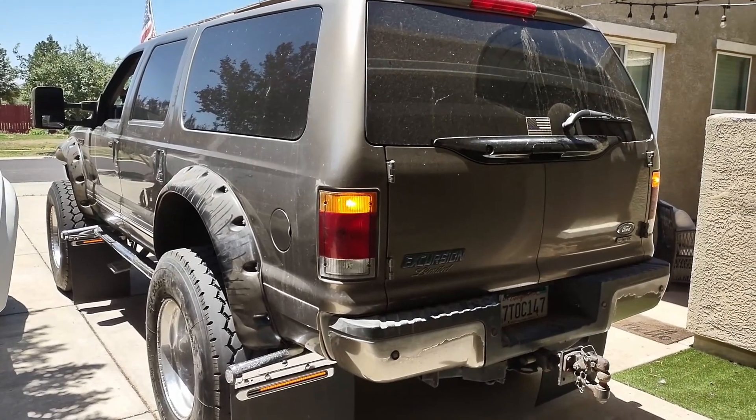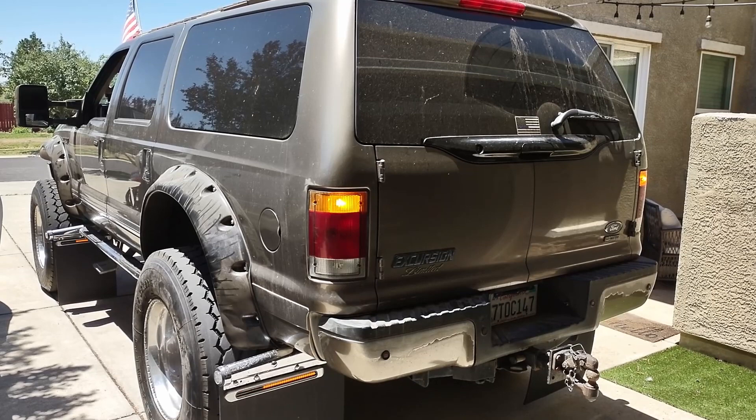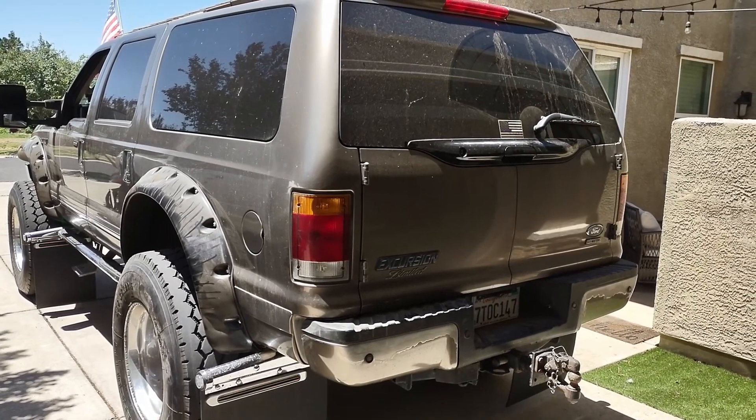This is the 2003 Ford Excursion diesel with the tri-color amber tail turn light conversion. The reason I do this mod is that with just the rear red, adding that yellow turn has more visibility — separate yellow turn signals, the brake light and tail light activated independently, and the turn signal can be blinking yellow at the same time your brake lights are on.